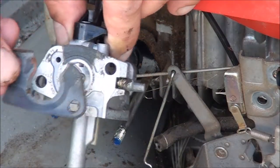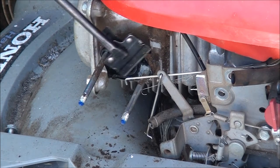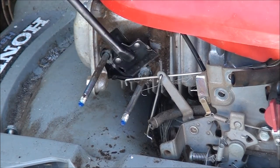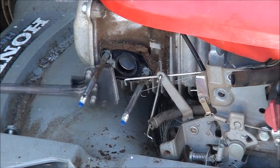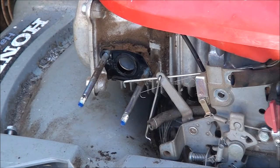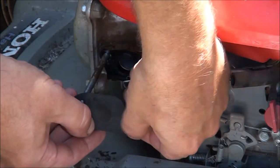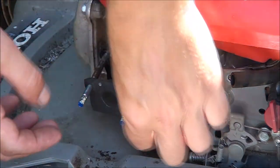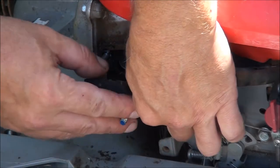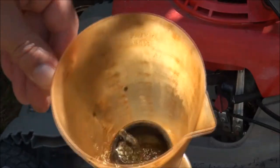With the piece here I can definitely match it up and use it as a template. I want to make sure to get rid of all the old gasket on here. Be careful not to scrape anything because it's plastic. My gasket didn't turn out too bad — it should work. I want to make sure to clean off this gasket surface as well. I've had the float and the float bowl soaking in carburetor cleaner overnight, so hopefully it's all cleaned up.